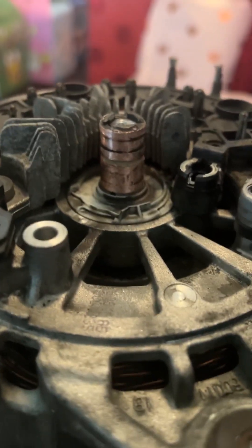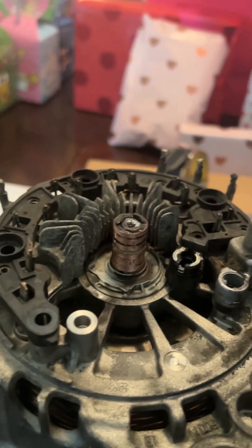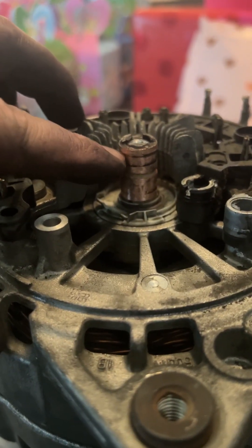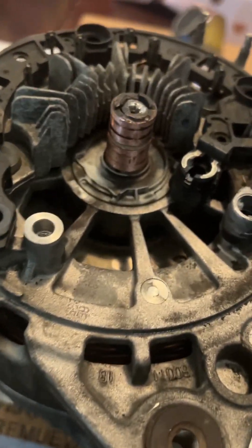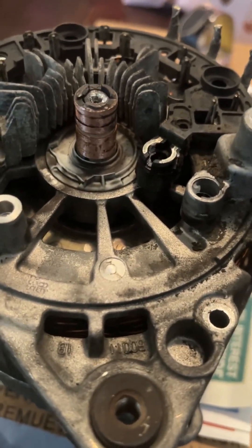The issue with this one here was that this piece connects with your brushes, and the brushes themselves had worn out. This upper top section here — you can see a little bit of the residual black — was totally and utterly worn out. The upper brush was no longer contacting, no longer making power.